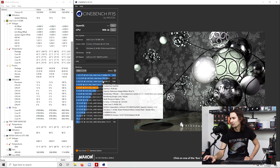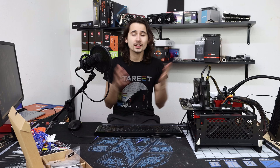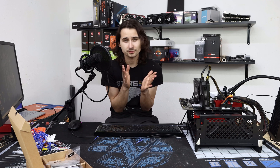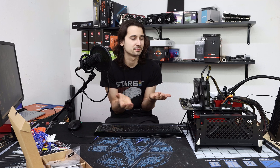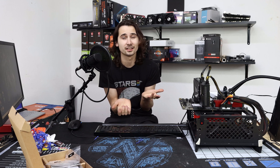So yeah, I think that 10,047 score was actually while we were clocking it up to like 5 gigahertz, because we did the D-Lid and then we clocked it to like 5 gigahertz, and we were like holy smokes! And then we shipped it to Jeff, and after about 10 minutes of running he said it just turned off on him and it wouldn't turn back on. So I think literally all it was was just cleaning that substrate and getting it reseated in the socket. So if you're having some problems with your Intel, you might want to look into that. That's literally all it was — you saw me open the box, literally take it straight out, take a good look at it, see that there was some gunk on one of the contact pads on the underside of the substrate. We got that cleaned up with alcohol and toilet paper, plugged it back into the motherboard, fired it up, it booted right in on the integrated graphics. We plugged the GPU in to make sure the PCI slot was working, and ran some Cinebench just to make sure all the cores are working and overclocked as they should, and it's nice and cool.